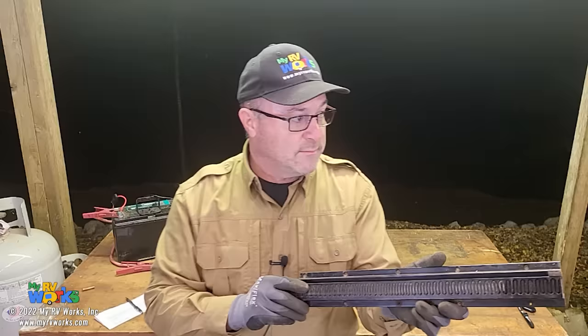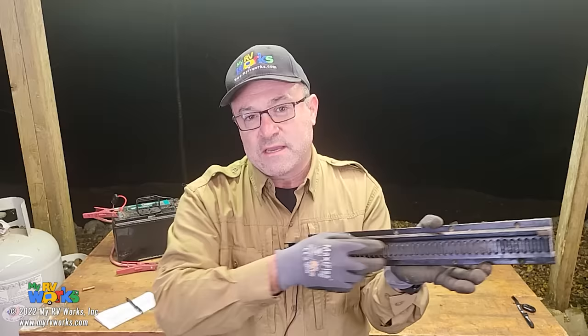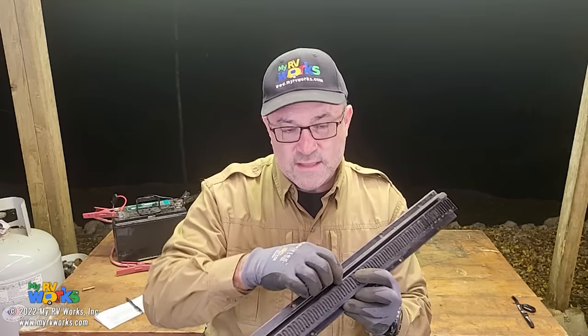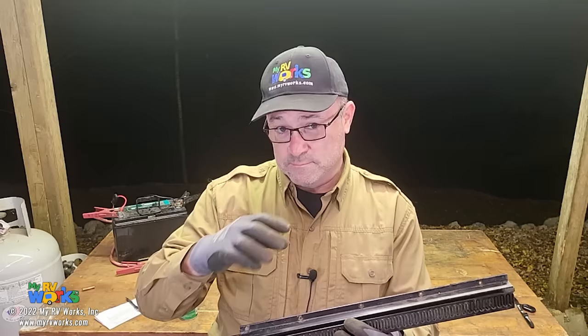But if you were to move that thing back and forth, it should be nice and smooth going back and forth. If you don't lubricate it, it's a hard plastic against aluminum, with a coefficient of friction between the aluminum and the plastic. It's going to sometimes get kind of hard, and now you're going to have broken spur gears. You're going to break the little fin off that has a little plastic shoe. I don't think you're going to burn up your motor, but your motor might fatigue a little bit because it's working really hard. So, Dave, lubricate that.